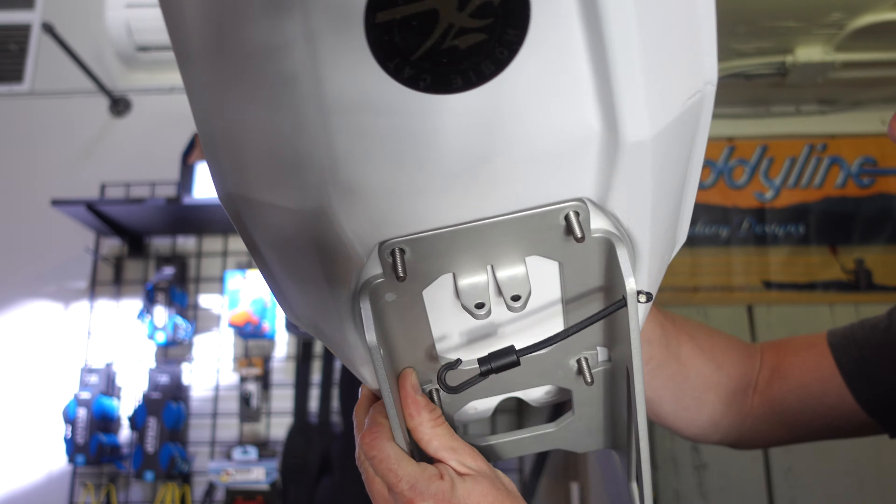After you attach the plate at the front, we're going to attach the back H-rail to the plate. They come set up together — after you break them apart you'll have the H-rail in the hole and the riser to the plate. You only use the riser for the 12; the 14 does not need the riser and will use a smaller bolt, but the rest is the same. It goes around the bar and clamps. Stage the spacer and the top part of the bracket underneath before putting the bolts in to make it easier to line everything up. Then put the nuts and washers on top.